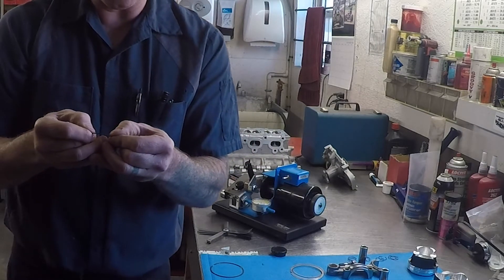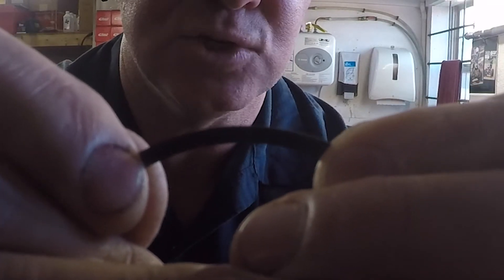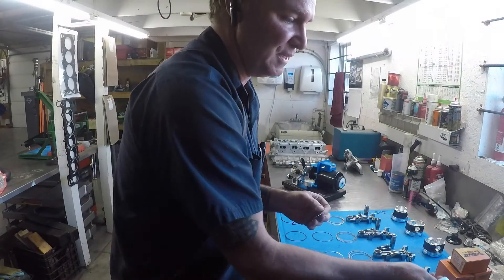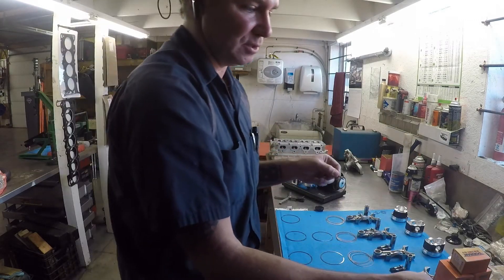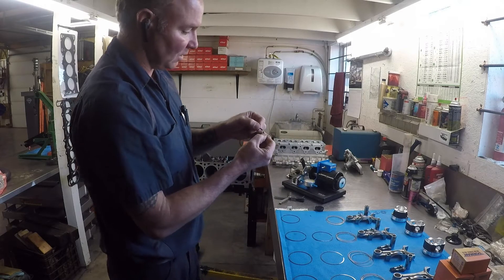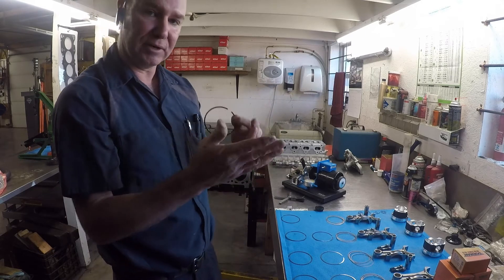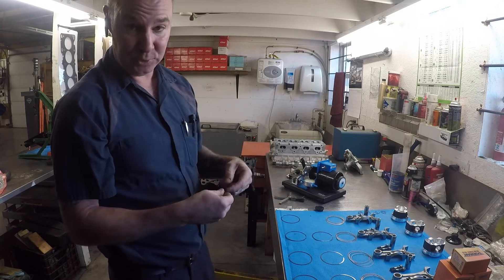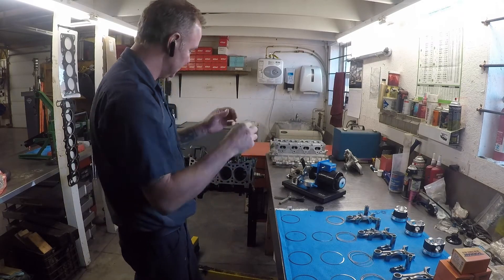To confirm the ring is square, you can squeeze the ring together and make sure the ends touch perfectly. On this style of ring you have a tendency to get a little off. The problem is that if the ring ends aren't square with each other, you'll have a variable gap — a much tighter gap on either the front or the backside — and that is not good for sealing. So we want a really good square end gap and we've deburred it.